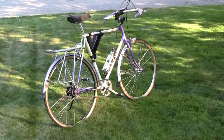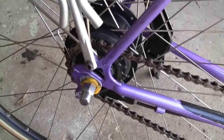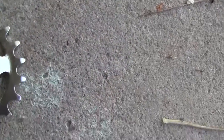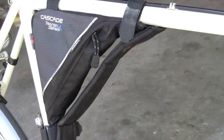For any gear nuts, the chainwheel has 42 teeth and the rear sprocket 19. This gives a gear range between 30 to 90 inches, which suits me fine, and of course there are no duplicates. Nexus sprockets are easily available in various sizes and cost $8 each. They are retained by an easily removable circlip and are also compatible with Sturmey-Archer internal hubs.